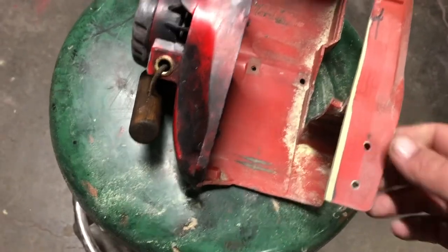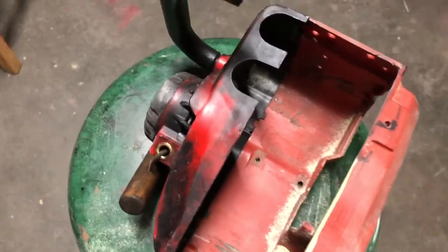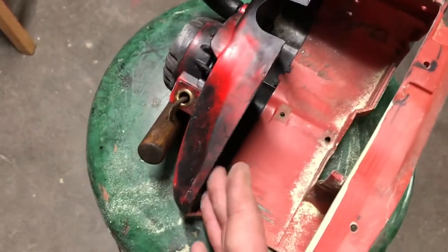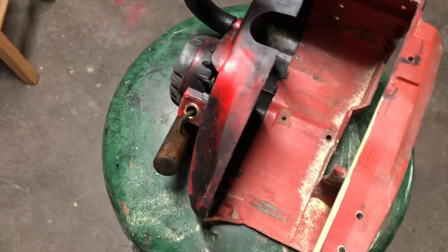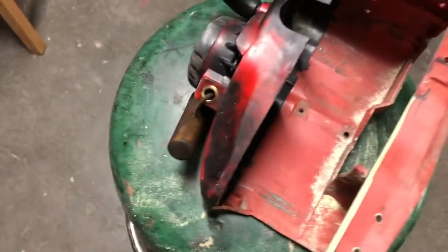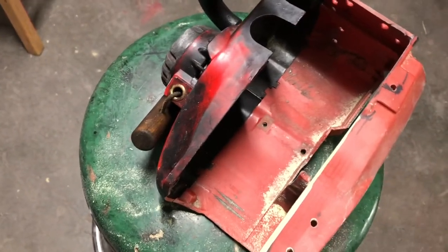What you want to do first is put a nice bottom structure here. There's a piece of metal right there that is glued in with Loctite super glue. I just needed a thin pass throughout here, so I put that panel all the way through. Your top needs to be done — bonded and painted so the thickness is correct — or you need the top you've bought on hand. I took my top, sat it down, and pushed it over to check my gap size, because you want the other edge flush. I use milliput — milliput fixes about everything. I wouldn't suggest bondo; it's not as hard or structurally sound as milliput.